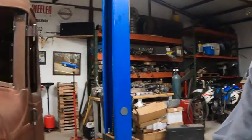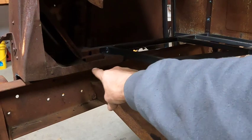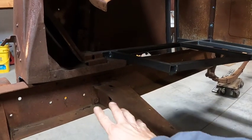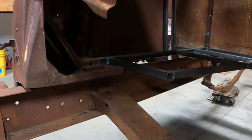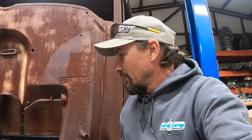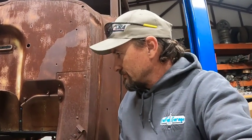We've got the cab setting on the chassis and I'm pretty happy with it so far. The front of the cab is still up higher about an inch more than the rear. The original supports on the truck are about an inch lower than what the subframe for the floor would be. When we rubber mount this thing, we'll have bushings in the back and some bushings in the front, just to make it ride a little bit better. It is going to be a rat rod, but I want to be able to drive it and be comfortable with it, so we will rubber mount everything. I'm liking this — I've got plenty of room, and that's kind of the guessing spot on where to fit the cab the best.